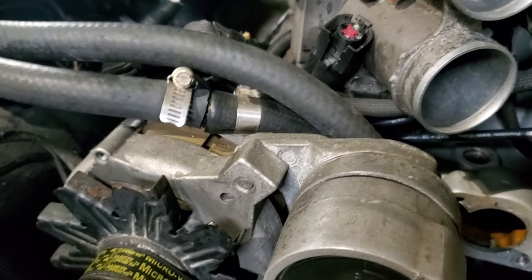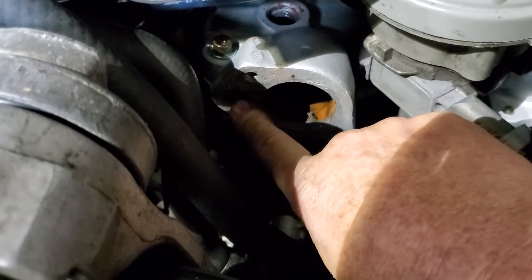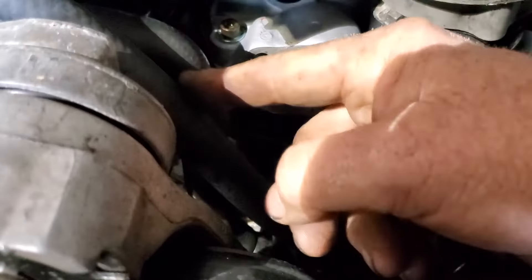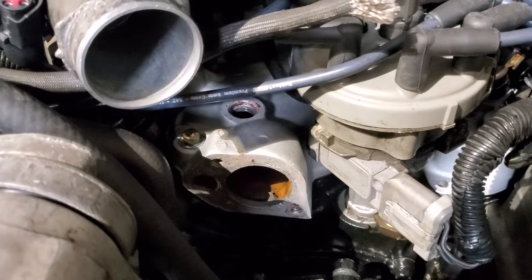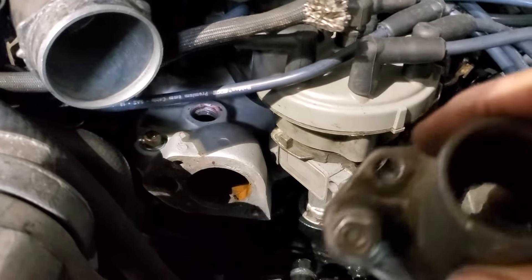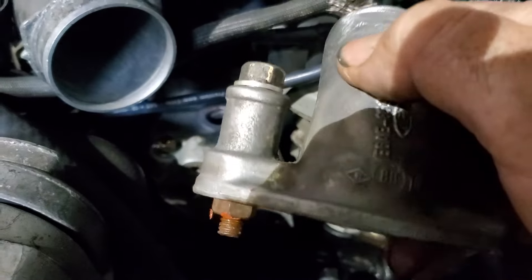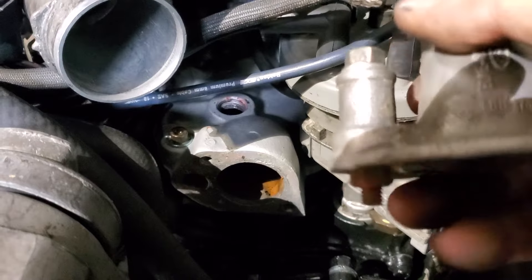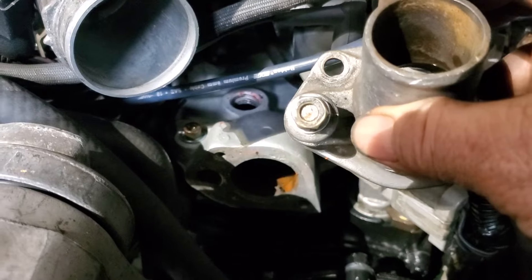When I got in there, see this hole right here — that's a bypass hose, it returns back to the water pump. As you can see, there's something wrong right there. This is what I found: you can clearly see there's supposed to be a hose attached there. Somebody had put a bolt in it, packed it full of silicone, and mounted it back on there.